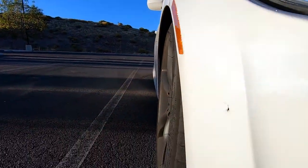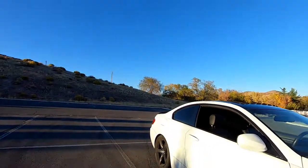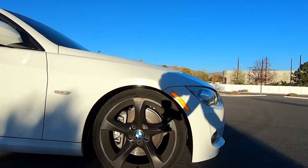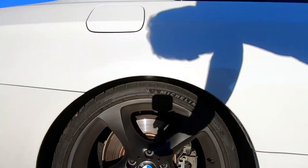As you can see from the front of the tire, the top of the tire is actually sucked right in and tucks right underneath the fender — which is what I wanted. It handled a little bit better on the track, a lot less understeer, which is what I read in all the forums. It's always nice to see in person what people actually talk about. One thing I was worried about is that the thickness of the plate would raise up the front of the car by that amount — this one was 6 millimeters. But honestly it isn't too bad; from front to rear the car is still fairly even. I do plan on putting coilovers on later and that'll fix that problem.